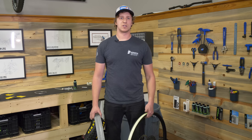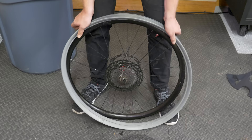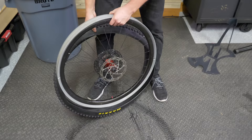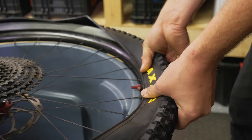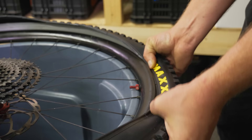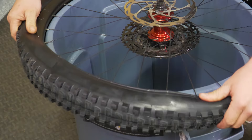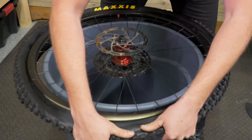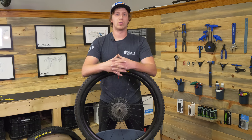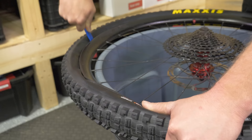If it's a brand new insert, a really important part of this is to work smart, not hard. Gravity is your friend — you have a lot more weight pushing down than you do pulling up. I like to start from the top and stretch all the way down; I have a lot more success with it. Next, get the tire over the CushCore. The best technique once you've got the tire over the CushCore is to get your first bead set by the valve so your logos are lined up. Then keep tension forward on the tire — continuously pushing forward, one hand on one side, one hand on the other. The whole idea is if you keep tension on that bead hooked up into the rim, it won't try to pop itself back out where you started. Then set the second tire bead in by stuffing that tire bead with the tire lever all the way underneath the CushCore into the center of the rim.